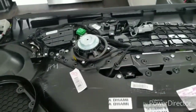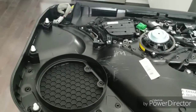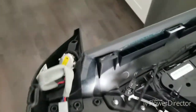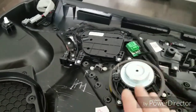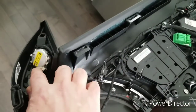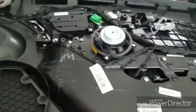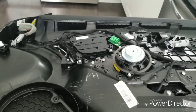All right, so the subwoofers or mid-bass are installed in the car, and the next portion we need to do here is to install the mids and the highs. So there's a few things that I'm going to need to check first. The first thing is I need to make sure that the mids and the highs are on completely separate channels coming out from the factory amp, that there's not like a capacitor or something that's basically blocking out the lower frequencies from this. So this way, when I go to connect the amplifier and the crossovers, sorry, to this, that they're on their own channels, they're doing their own thing.